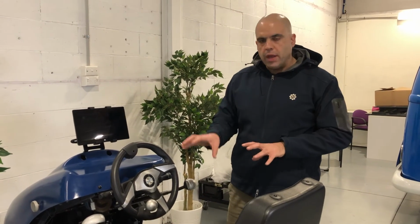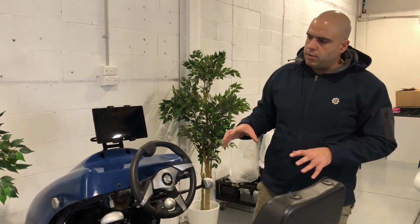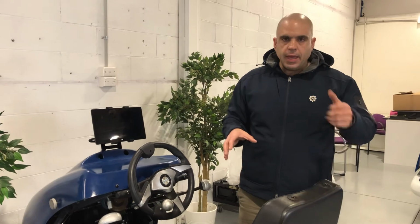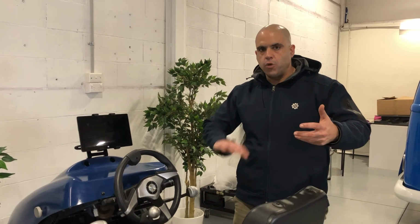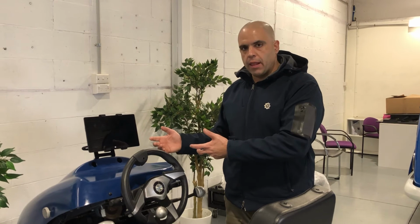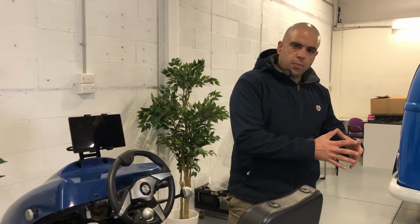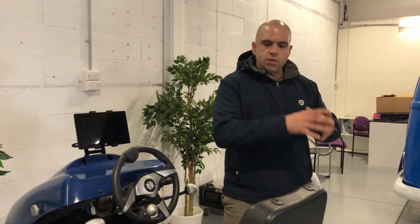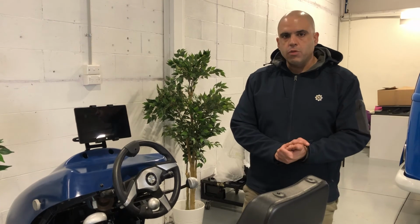So the reason we had this video, and it was a bit of a quirky question, is that normally you would have hand acceleration and hand braking, but what these guys are asking is, can I have hand acceleration and foot braking? And as long as it is assessed by the allied health professional to be suitable, and as long as you're using compliant products and you've got an engineer certificate for all your modifications, as we always talk about, there is absolutely no problem in doing that. So hopefully that helps with that question.